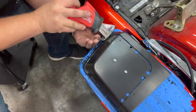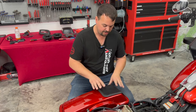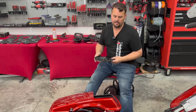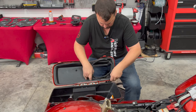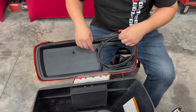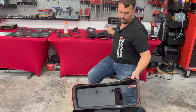I've vacuumed up my mess and removed the tape. We've taken the outer portion of the grill and checked from underneath to make sure everything lines up and fits — and it does. The next step is some slot modification. If you go to slide this in where it goes, most of the time you'll find it hits right on this ear, so we're going to trim it off down to the base. I'm going to use a set of side snips and cut down to the base.